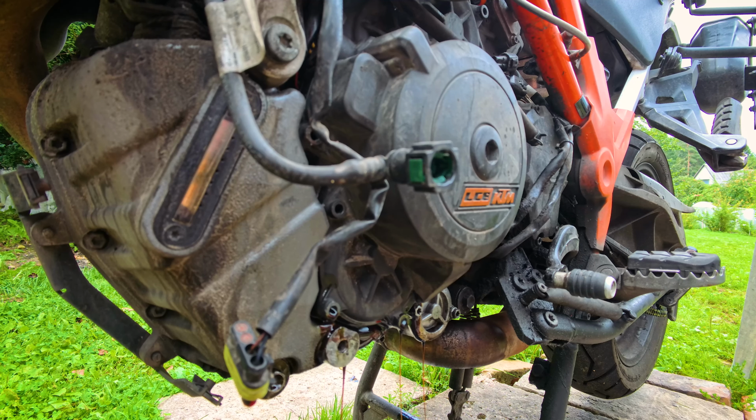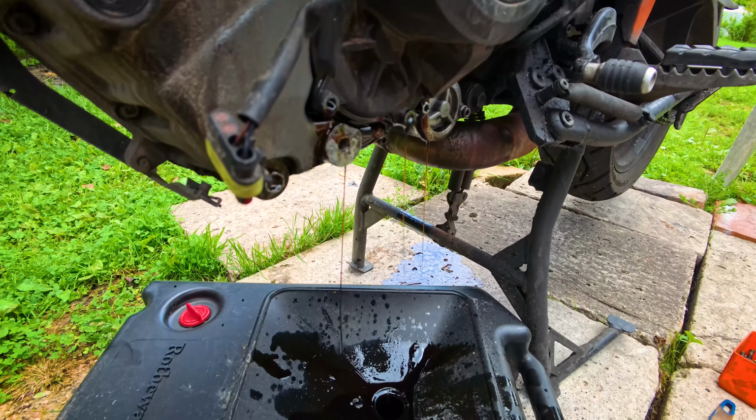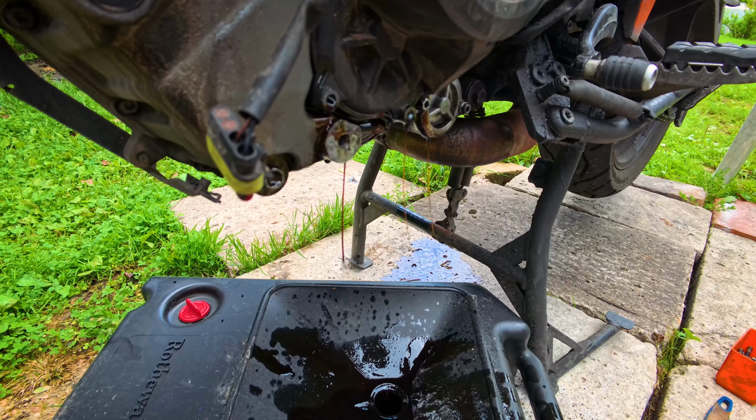So there are three gears from the starter. They have axles, which are inserted into this cover. The cover can only be removed by pulling it absolutely straight out. But because of the magnet, the cover is constantly trying to warp and jam.